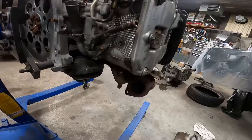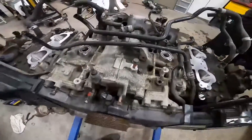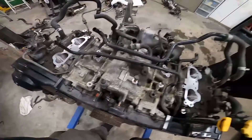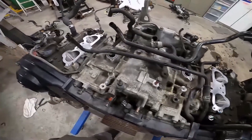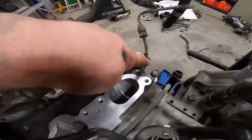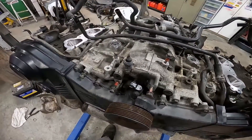On this one we're using his domestic turbo because this engine came with a TF-035 turbo, which is a little bit smaller than the domestic TD-04. This guy didn't damage his turbo when his engine went, so we can reuse that. Also, no matter which way you're going to install this, remove all the banjo bolts and take out the little banjo bolt screens because they like to clog up and kill motors.